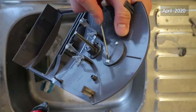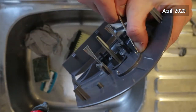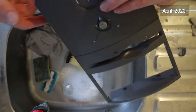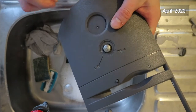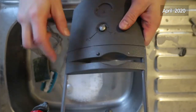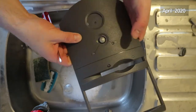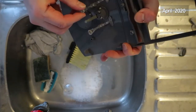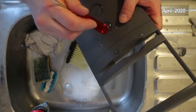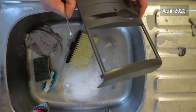You just bend these tabs up at the back like that - sometimes they're a bit of a pain. Obviously you've got to get rid of that bit of plastic there but the button will still work for now. There's actually a spring in there, so probably blasting that with a compressor before I put it out to dry might be a good idea to get any excess water out. Got to be careful not to snap these light pipes off. It's a bit daft de-Dell-ifying it in some ways, because there's a great big Dell logo embossed and stamped in on the side.